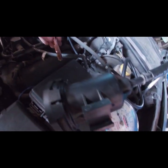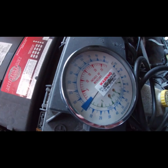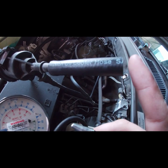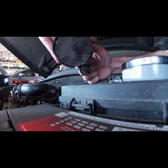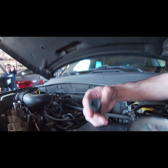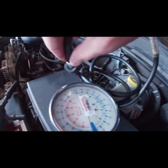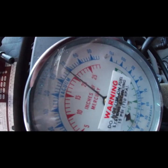Same thing as the other Lexus — the line comes out here for the canister, goes right to the bottom of the purge valve, and here's the manifold vacuum to the valve. Vacuum gauge on the other side, and it's electrically disconnected. Let's start the car. Zero vacuum passing through the valve — the purge valve is good. No vacuum. You'd hear it — like this — if there was a leak. That's what I'm looking for if I see a leaking purge valve.